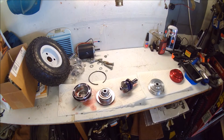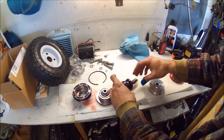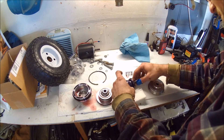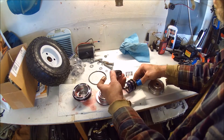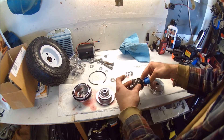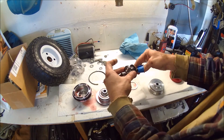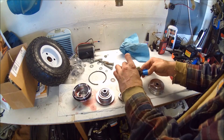My instructions say to use the OEM cushion spring. If it just applies a little bit and then grabs the rest — let's see — that spring goes there. There are two spacers on the end, this little cover, another spacer on that spring, and then that guy. So it does just clamp that spring a little bit before it bottoms out, so I'll probably be okay. That's just to keep it from being too harsh.